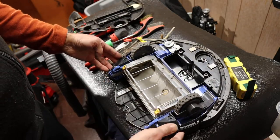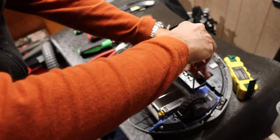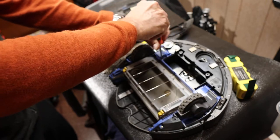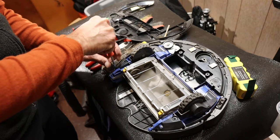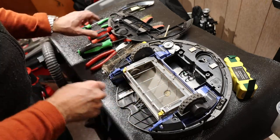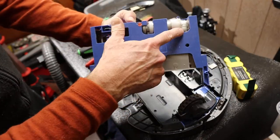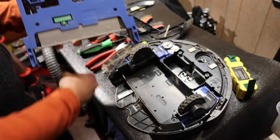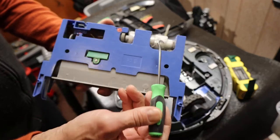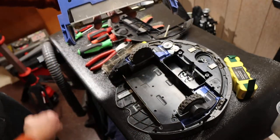If I want to go further I can dive in one more level and loosen four more screws that allow me to take out the railing that supports the brush module. I get my pick in here and you can see just how dirty it is in there. I'll go ahead and start with a vacuum first.